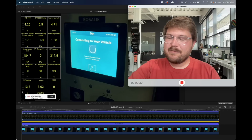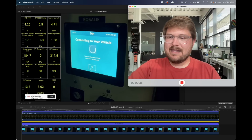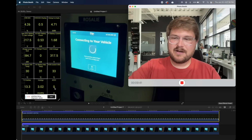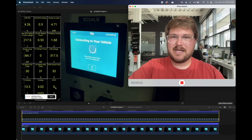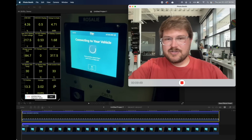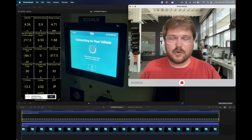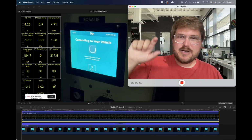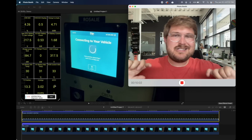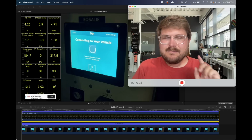We just have our 12-volt battery pack voltage, our high voltage battery age here, 3 months old. The truck was 3 months old. And then this is your air conditioning unit compressor. This is how many amps are being run to it. So when it does kick on subambient chilling, which is this bottom right here, this will show us how much power is going to it. This truck that we are testing has the max trailer tow option, which gives the cooling upgrade. And the cooling upgrade is purely just an additional air conditioning compressor in the coolant loop to basically double the cooling capacity, plus or minus. And that to me seems pretty useful.